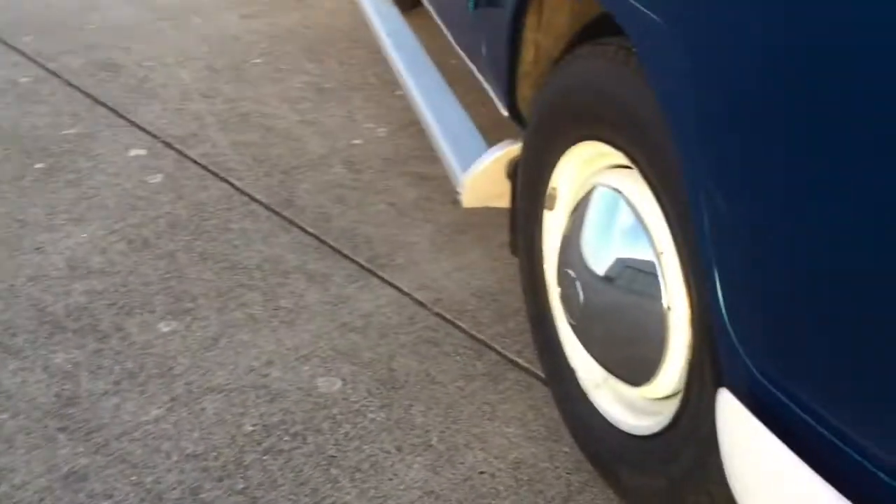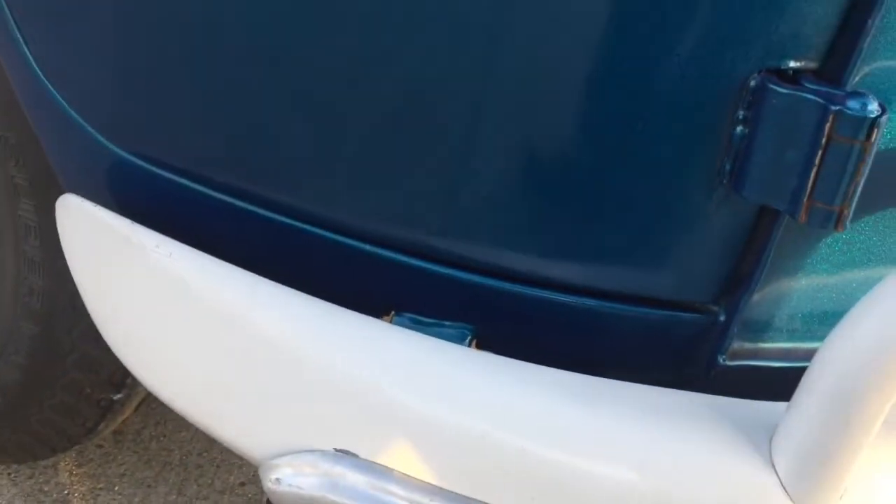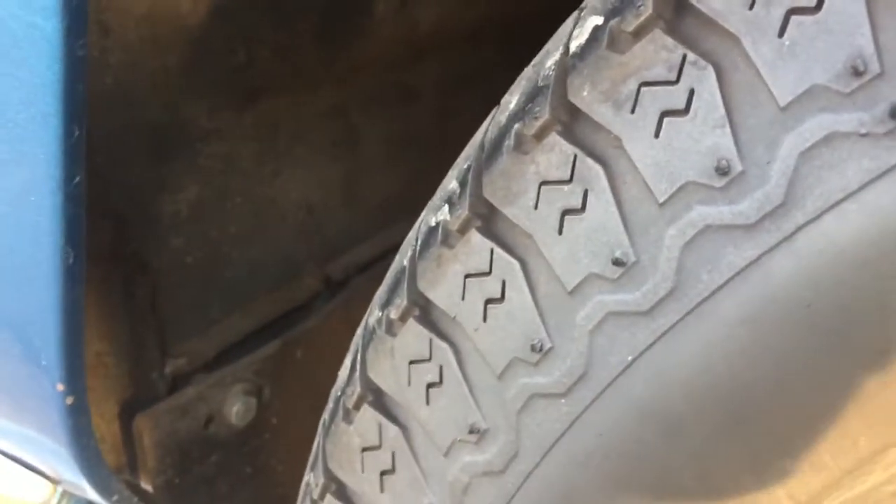Still have original floors. There's a cargo floor. Battery tray on the passenger side appears to have been repaired. The inside of the wheel wells on the passenger side front, back side of the seat stanchion, bottom of the front floor — these are normally trouble spots. Look down at the bottom of the rocker. Good shape.